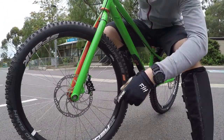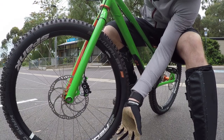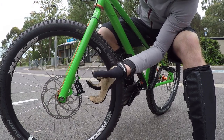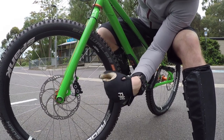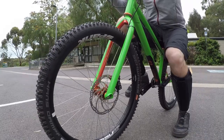The idea here is we're trying to wear off the machining marks that are on these rotors. They're punched out of a flat piece of steel, and we're trying to wear it in so it's all level and nice with the pads. We want to wear the pads in square to the rotor and get some nice marks going around in the rotation of the rotor.